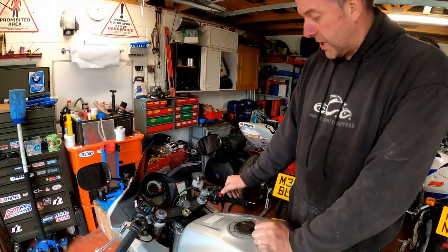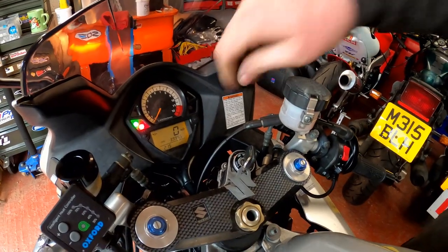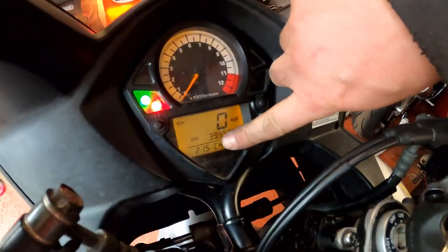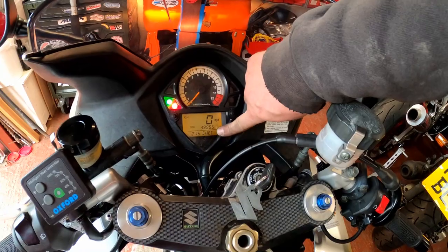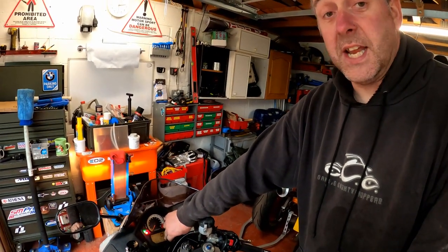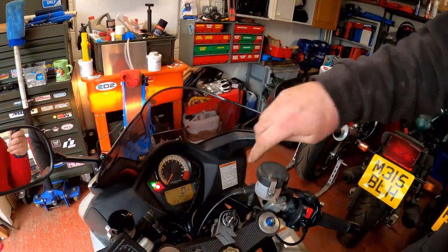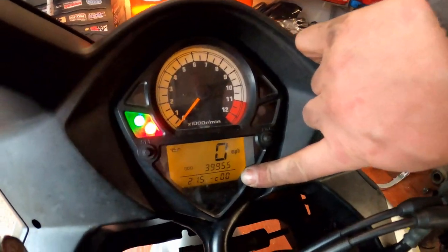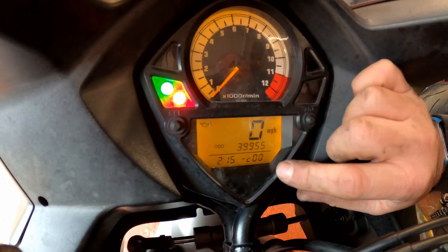What we need to do now is turn the bike on and have a look at the dash. Engine run/stop switch in the off position, then turn the ignition on. What we're going to be looking at is down here where it says 'check' — that's where we want to be looking for the codes. As soon as I flick the switch we should get a code up here. If there's no codes it should say C00. If it says C and then 01 or any other number, then that means we've got a code. Let's flick the switch — we'll hear the fuel pump prime. We've got a dash and then C00, so that tells me that my bike does not have any fault codes currently, which is a good thing.